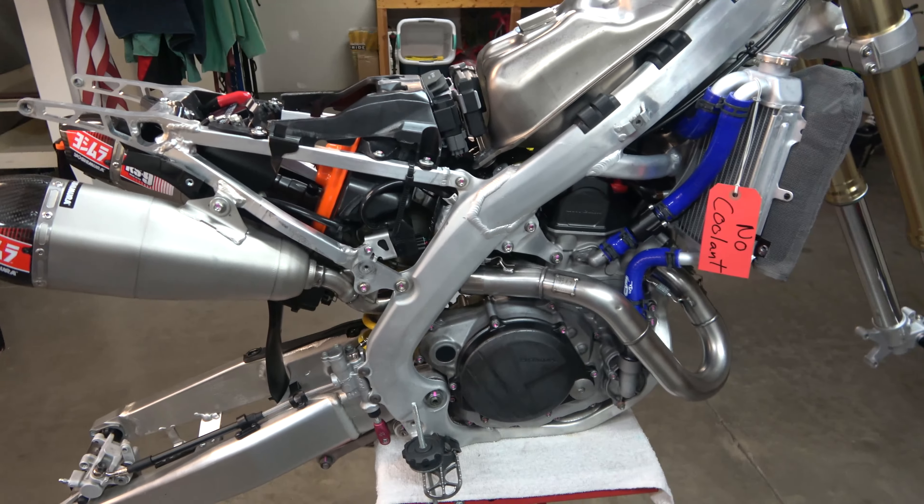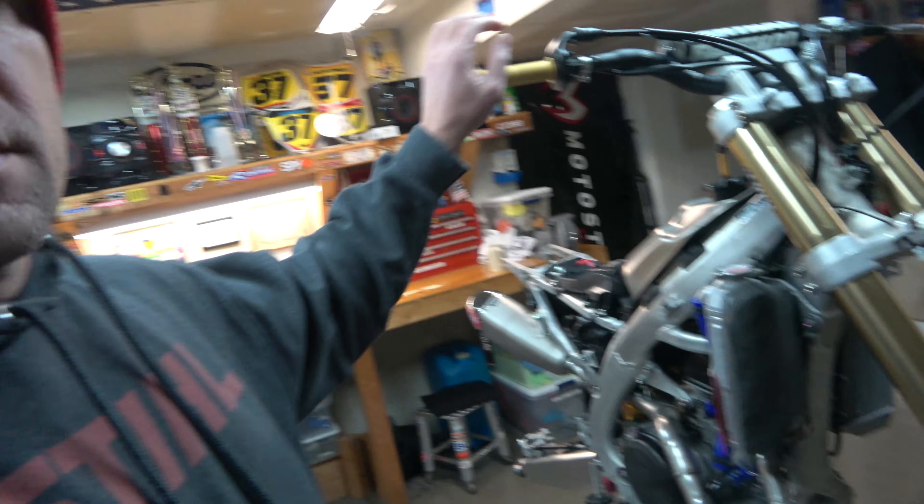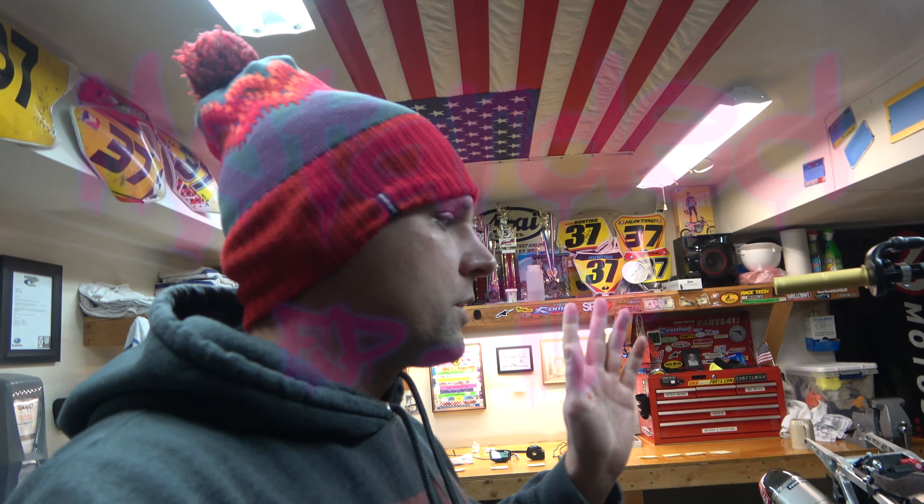So I'll set up a tripod to show me doing some sketching. I might find a website with an electrical design setup later, but for now I'm getting pencil and paper out and figuring out where each wire's home is going to be. I found these incredible Sumitomo electrical connectors that look exactly like the stock Honda ones - found them super cheap on cycleterminal.com for about three bucks each, available in 2-pin, 3-pin, 6-pin, 8-pin varieties. I also found military-spec sheathing, so I need to figure out how many connections each section needs.